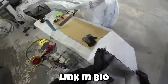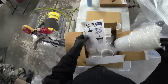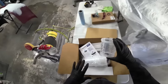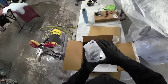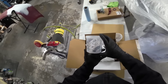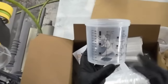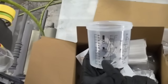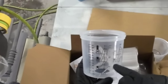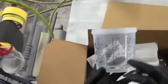I started using these inexpensive disposable cups. A few different companies manufacture these — this is Savito, but I also ordered the same style from Spray IQ. I like these cups because they're half the price of 3M. This is the 1.0 series, and I've really been enjoying them — they work well, easy to use, and I haven't had any issues. The measuring system has your mixing ratio at the bottom. So if you're mixing paint at 2 to 1, you put in the amount of paint you want up to the 3 mark, and then you add reducer up to the 3 mark on the reducer side. That gives you the one-part reducer. Very easy to use — don't let all this stuff confuse you.